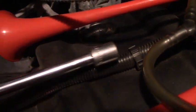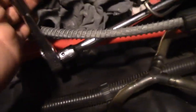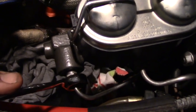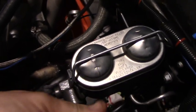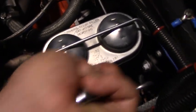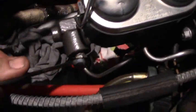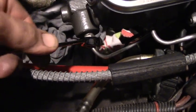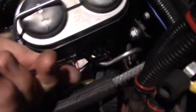I found a better way — a short 9/16ths, and you go up under the line and onto the nut. Now you can just tighten it up. The master cylinder is mounted. Just lock these down nice and snug — make sure you get them as far as they can go. Don't monkey-tight them, but you want them snug, because this is your hydraulic fluid that's going to stop your car and you sure don't want a leak. These are kind of compression fittings anyway, so you do have to drive them in so they take up the shape of the threads.